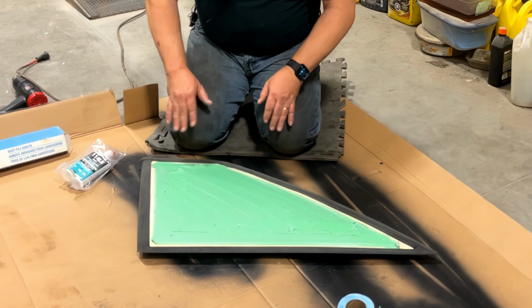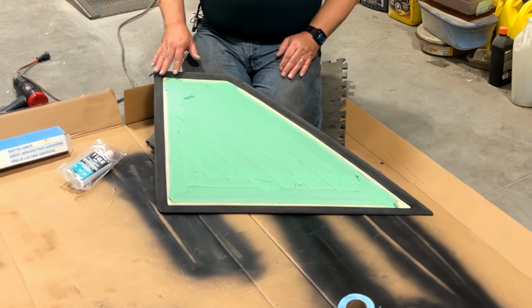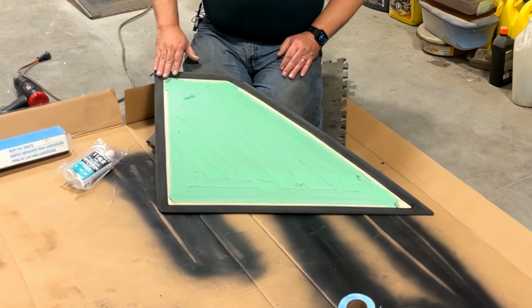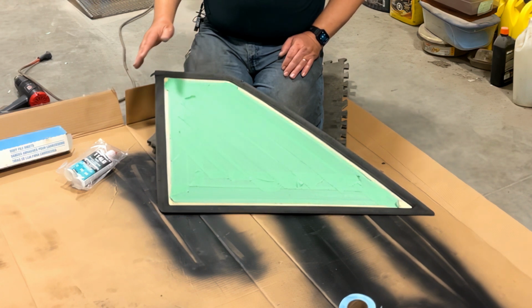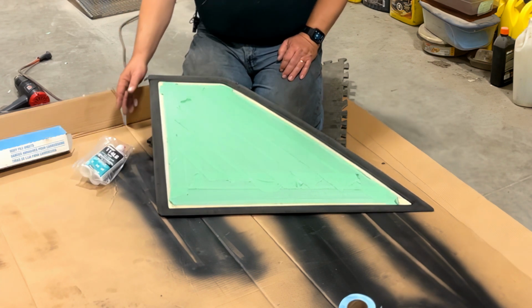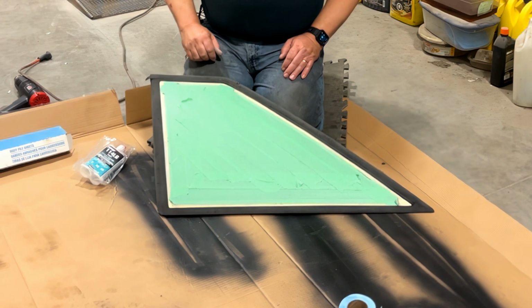So our next step, after having sanded it down here, is I'm going to use a water wash with Sunlight dish detergent, just to try and get any grease and whatnot, like from my greasy fingers, off of here, get that good and clean. We'll get it nice and dry. Then we'll start applying the skim coat. Once that has cured, we'll sand it down probably to about 400 grit, and then we'll prime and paint it.